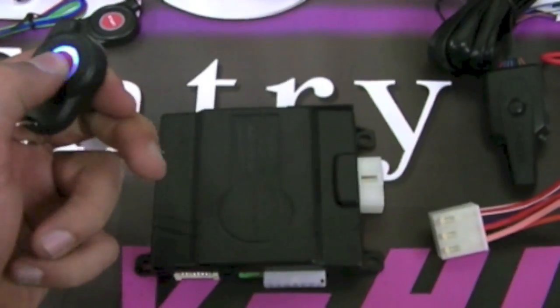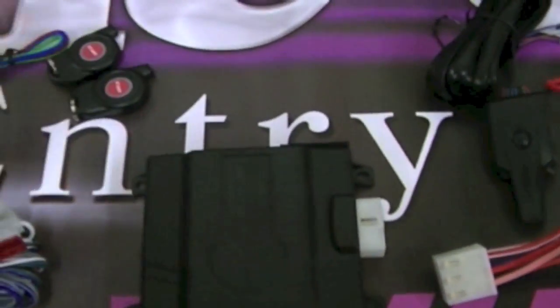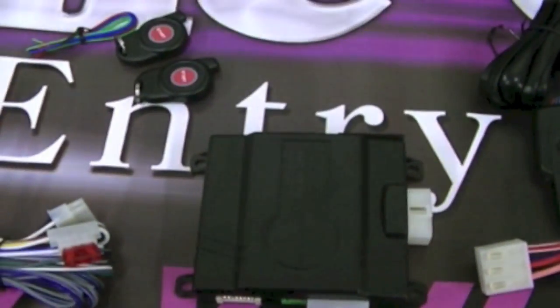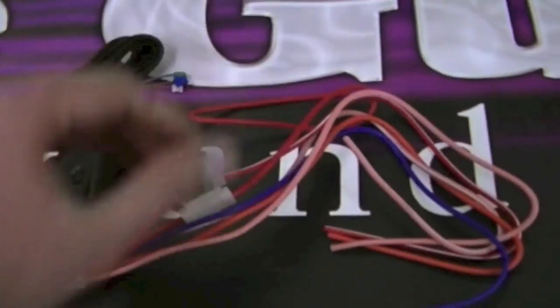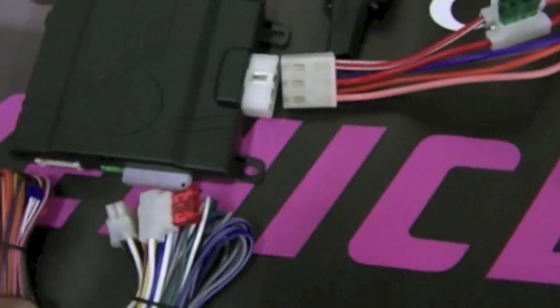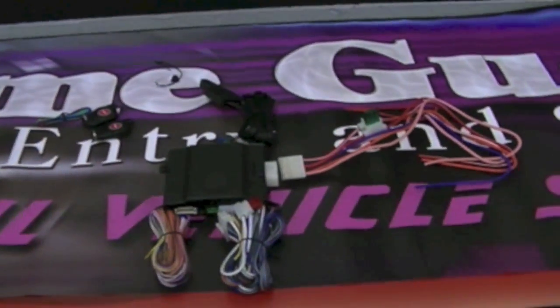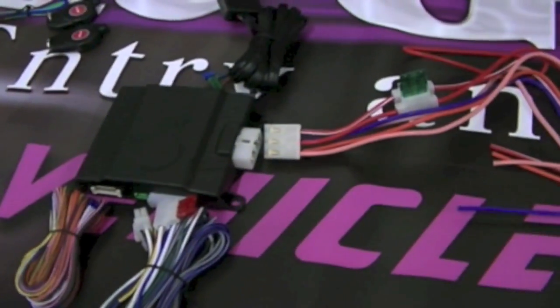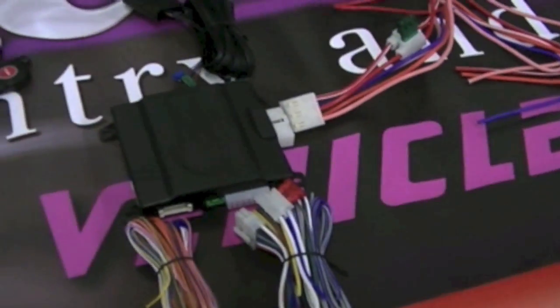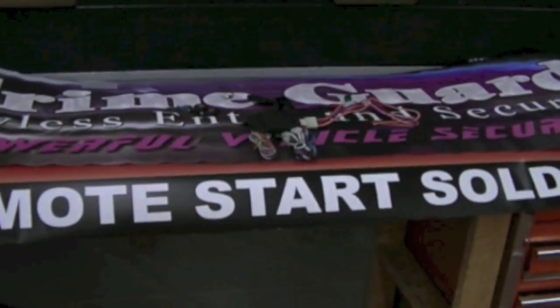These are nice OEM-style factory key fobs, which work great for Dodges, Fords — a lot of times they already have unlock, lock, and trunk release on the key, so it's nice to just add a single-button remote start. A lot of these harnesses are wrapped in a friction tape that looks like fabric, to make it look very factory. The blade is plugged in here, the main harness is plugged in here, the interface module harness is plugged in there, and the antenna runs right up to your window. I hope that gives you an overall idea of how remote starters work and what's involved in getting them installed. This is Gatlin from Carfunics — thank you for watching. The next video will cover the actual installation of a remote starter.